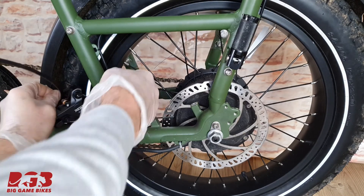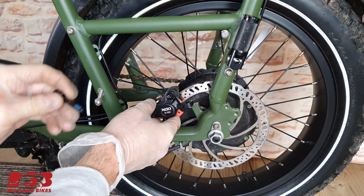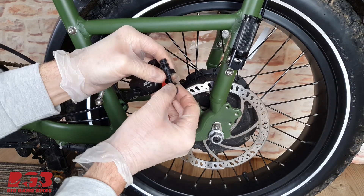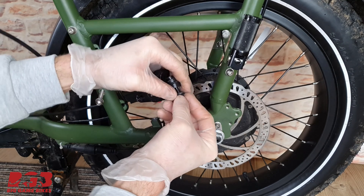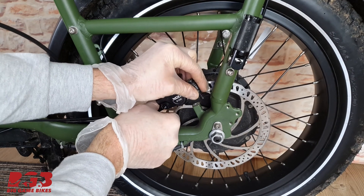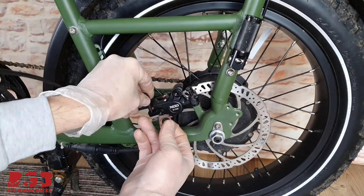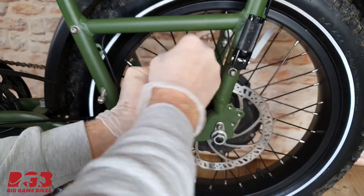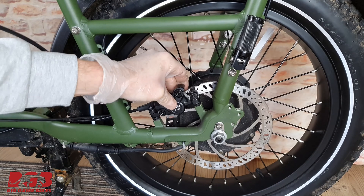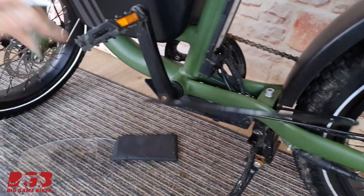Grab your caliper, make sure to feed this behind, put this bolt through, grab your washers. At this stage you can remove the red tag because we're immediately putting the caliper over the brake rotor. I haven't done these up tight yet — there's still some movement and that's because we're going to adjust it in a moment. In the meantime let's finish feeding the rest of this hose through the bicycle.